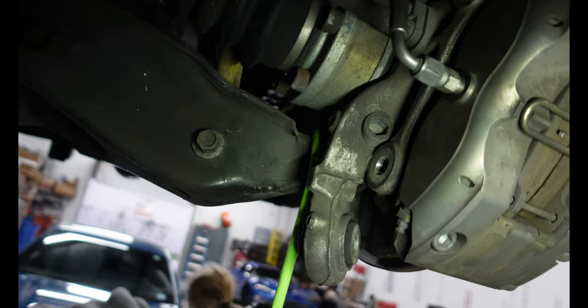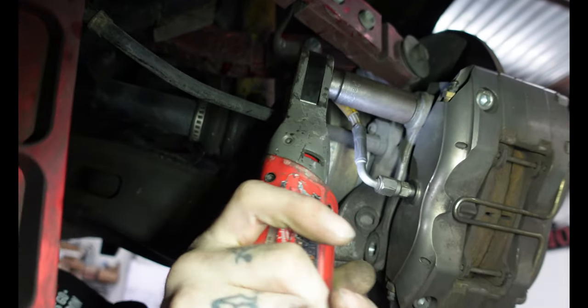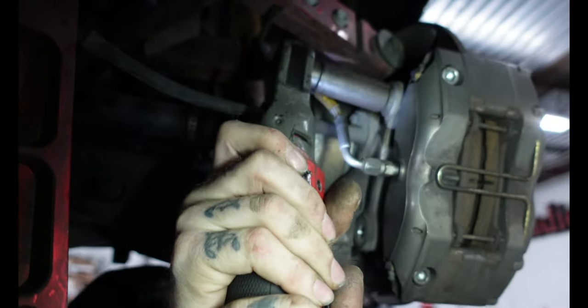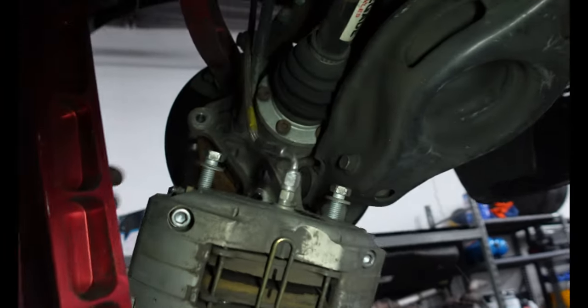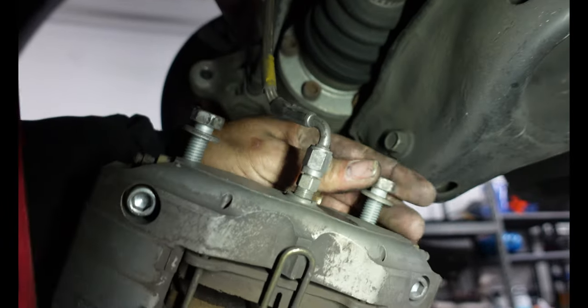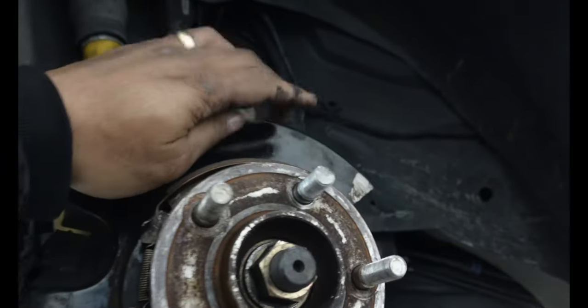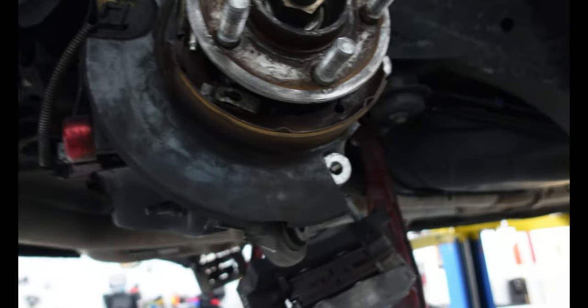So now we're taking off the brakes and calipers — that's the lower bolt, now we're going to take off the upper bolt. A lot of pressure. The caliper is hanging; I put the bolts right back in location so we know where they're at. Now we have the area to do what we need to build it out. Cut the retaining clips off, remove the rotor, which exposes the plate we're going to use on the backside to tie off the floating ring. That's what we're grabbing from. Now we're going to do the front.